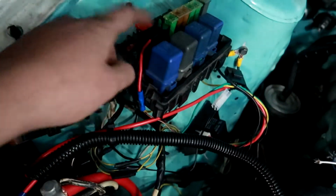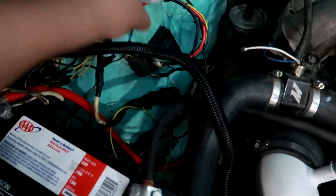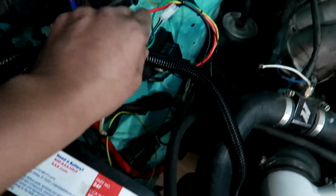And then we got the yellow wiring coming in through right here all the way up to the ignition switch, that's your yellow wire. The green wire we did not use, because it would just turn on as soon as you turn on the ignition and turn off with the ignition. Oh, there they go on again. That's how you know they're working. And then the ground wire is just a black wire that goes to my other ground. So that's pretty much it.